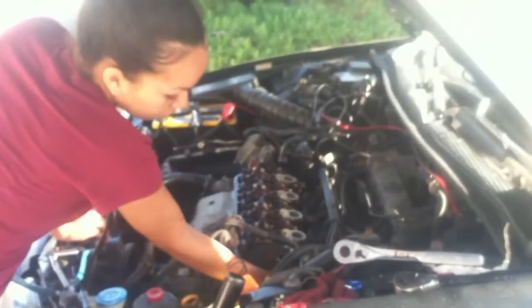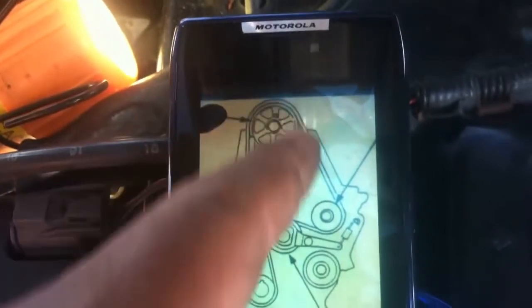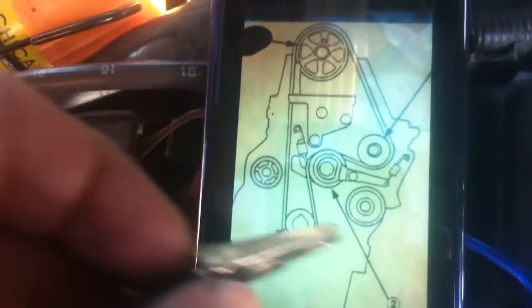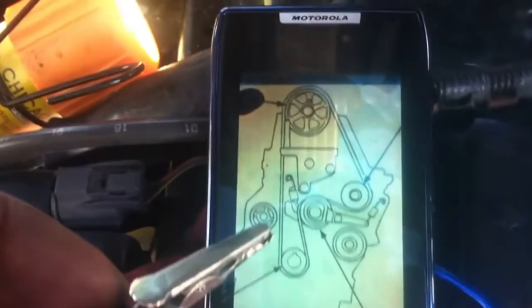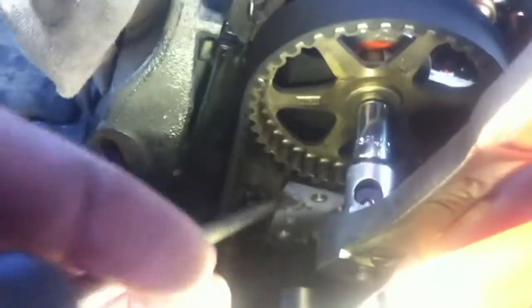Clockwise — when I apply a force clockwise on the camshaft, the belt here along this edge, all this right here, is going to get tight. While this down here stays tight also, from the breaker bar being attached to it with the socket — and this spring right there — we're going to help it. What we have there is a little wire right here, a wire attached to the arm. Tight wire. While my daughter pulls up on that, she's going to tighten this lock nut down there attached to her ratchet — 10 millimeter bolt. That's how you tighten the tensioner.